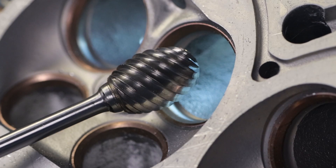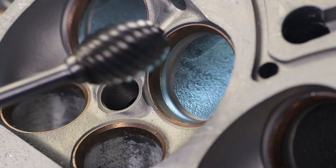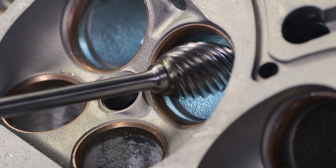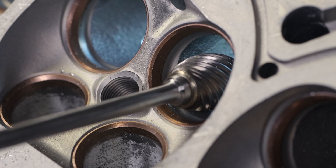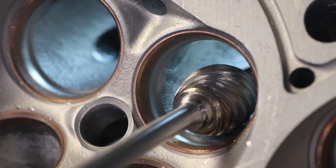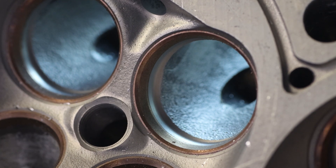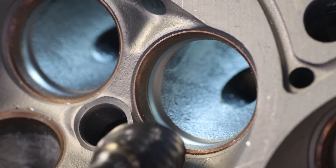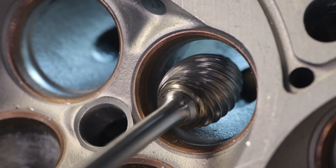Now for the intake side, we're going to use the Head Games 3/4 Super Spiral Burr — this is the Honey Badger. The Honey Badger of Burrs, because it doesn't give a care what's in front of it — it's going to take material out very, very quickly. I use this because it's a bigger hole and I want to keep it round. Because this is round, it's much easier to keep the shape so you don't have a lot of shaping to do. It is almost the same size as the port. If you have a smaller burr, you have to shape it — you're doing all this extra work. But when you're doing it on the intake side where you can put a bigger burr in, it is really advantageous to use the biggest burr that you can stick in it, so you do not have to worry about shaping.